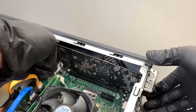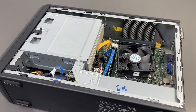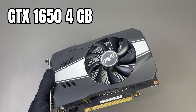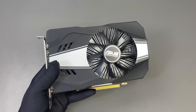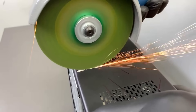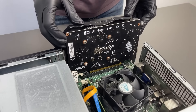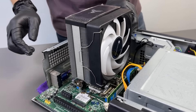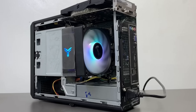If I actually want to see better graphics, that's where things get tricky. This tiny case only fits low-profile GPUs, and that's a huge limitation. So I came up with a crazy idea — what if I just cut the case open? I'm gonna cut off part of the chassis so I can fit a full-size GPU inside. And the one I picked? A GTX 1650, 4GB, single fan version — still compact but way more powerful than the GT 1030. I grabbed my cutting tool, a few sparks and a bit of metal dust later, and done. Now the new GPU slides in perfectly. I'm also swapping out the old cooler for a bigger air cooler to help keep the CPU nice and chill.